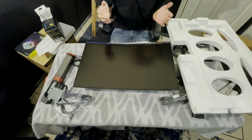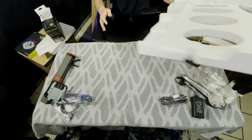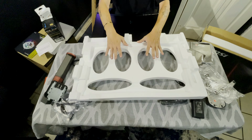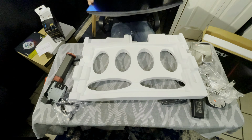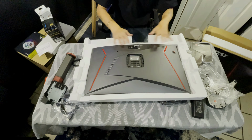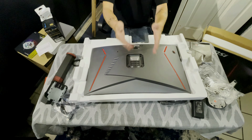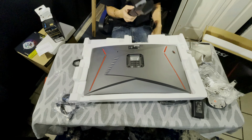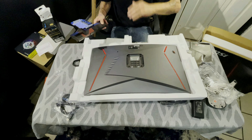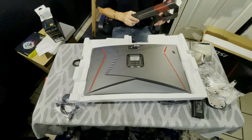All right, to be safe, the best thing you could do is take your panel and get the foam it came in. The foam where the glass part would go down, the monitor part, the screen itself. So this way, it's being secured. The whole screen's being secured by the foam that it came in. Now you could put your mount on without worrying about putting pressure down on these. Do not do that. You can easily crack the screen, break stuff. So please, please, please don't do that.